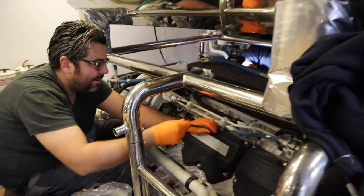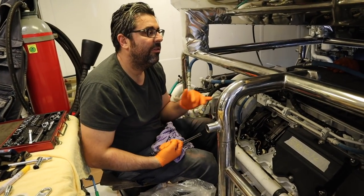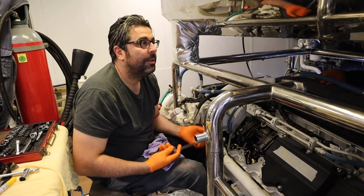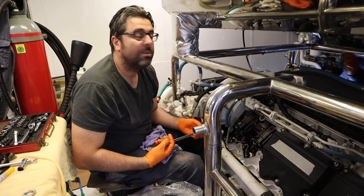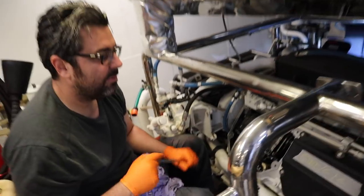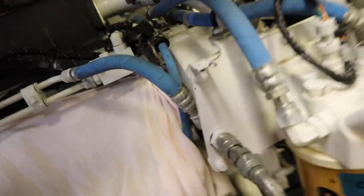What's the estimated time for completion of the work? For removal and then reinstallation we need at least two and a half days, because we have to check all the valve lash, injector lash, and the rocker arms — so we need a bit of time. Not too bad, and it's not summer so you're not sweating your balls off!